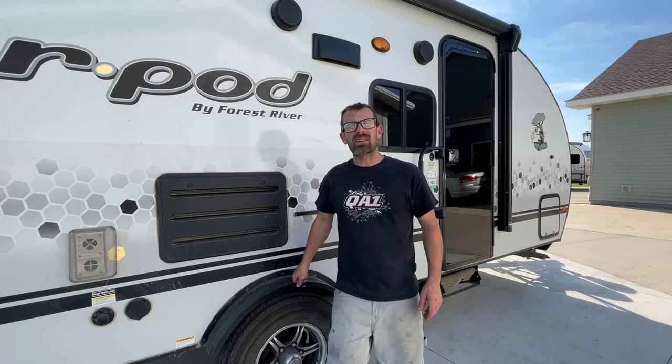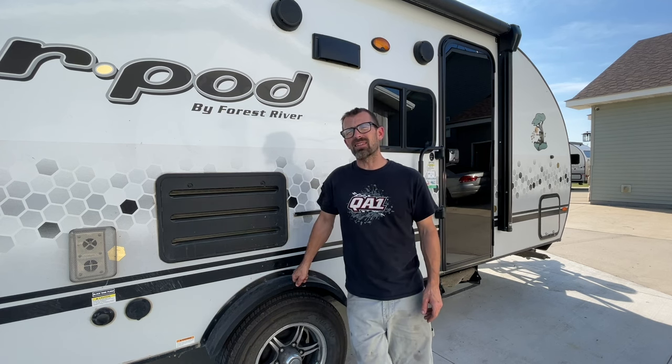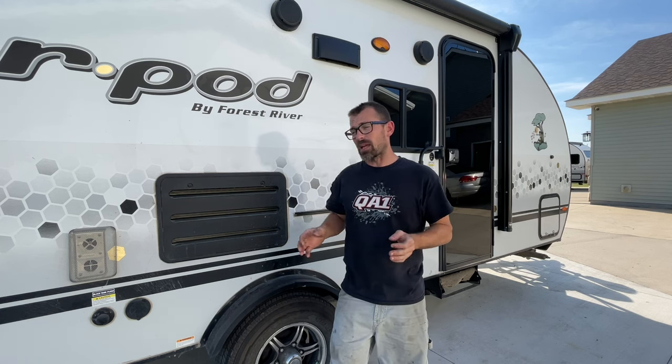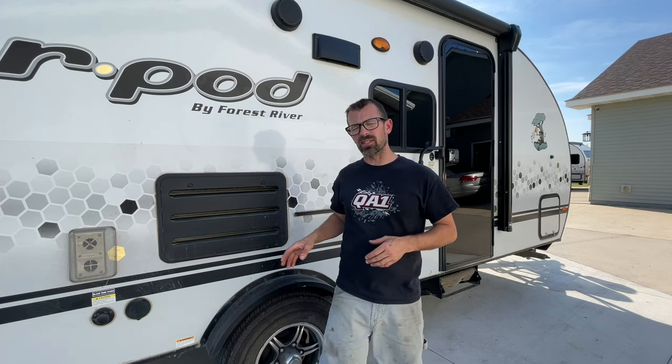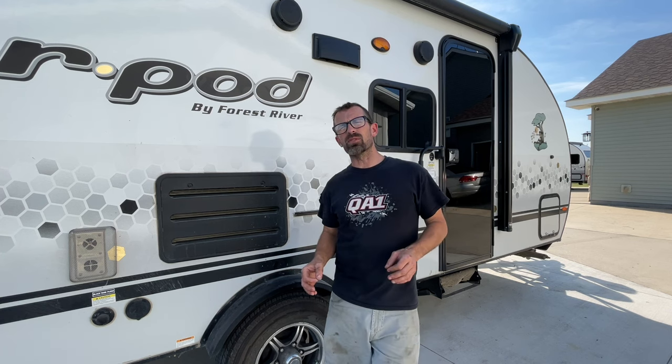So back last fall, I was looking at the camber on two of my campers, the 21-193 and the 20-190, and I had a lot of negative camber. I'll get a good shot so you can see what's going on with this thing, but it was enough so that I was a little concerned about it. If nothing else, you're gonna have uneven tire wear.